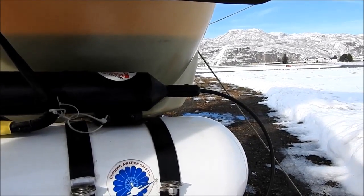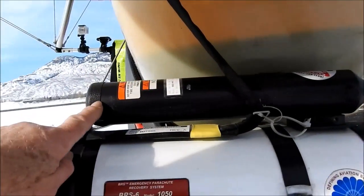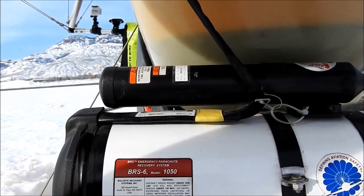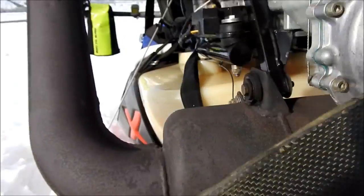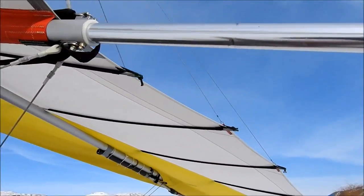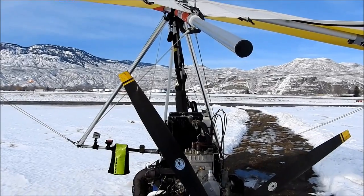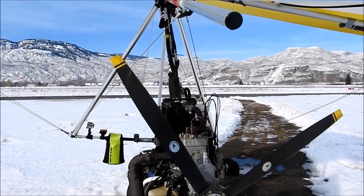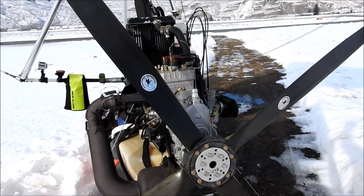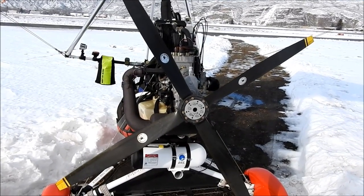And basically it's like a gun trigger. When I pull the handle, the hammer hits the igniter, and the rocket will shoot this way. And there is a cable which is wound here and attached to the parachute. And this parachute is connected with Kevlar braid, all the way up and around, to the top of the wing. So basically, if I would be in trouble, I would have to turn the engine off, pull the trigger, and this parachute will shoot to the side, and break all these plastic tie wraps, and hang from the top. And now I would be totally out of control — mercy of wind and surroundings — and hope for the best.